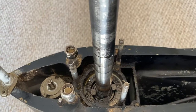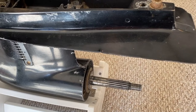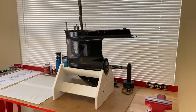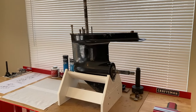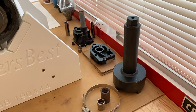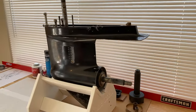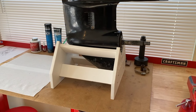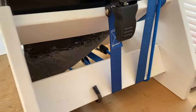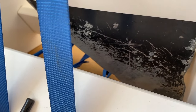We are going to shift our direction to the lower prop shaft and continue removing the prop shaft, bearing carrier, and all the internal gears. I've got the lower unit resting on the stand on the larger Craftsman workbench — the stand is perfect for stationary use. However, with our continued steps we may be tugging at it pretty aggressively, possibly with that tool to remove the retainer nut and using the puller jaws to remove the internal bearing carrier. So I'm going to secure this lower unit to the stand much more firmly by use of tie straps.